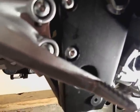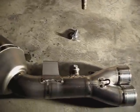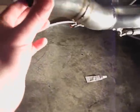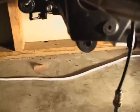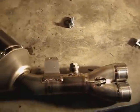Next, take the foot peg bracket that comes with the kit and attach it behind the existing foot peg. Put in the screws in the normal spot and torque it down to 18 foot-pounds. Then add the clamp that comes with the kit to the collector, fit the exhaust up there — make sure you use the grease on the inner side — then get your exhaust up there and bolt it down. You'll also want to put the strap over this section before you tighten everything down.